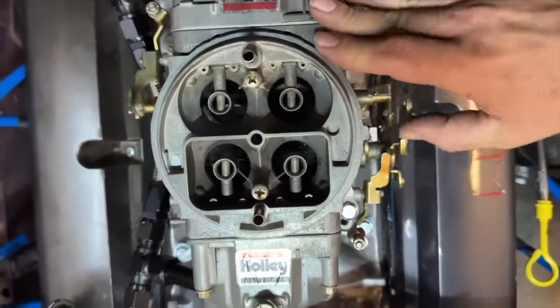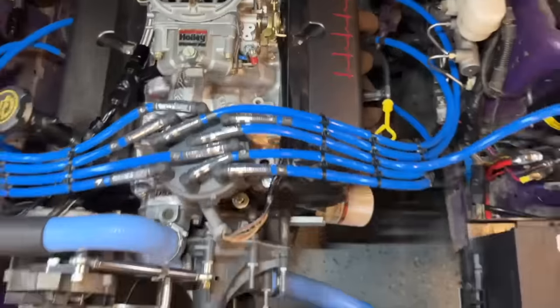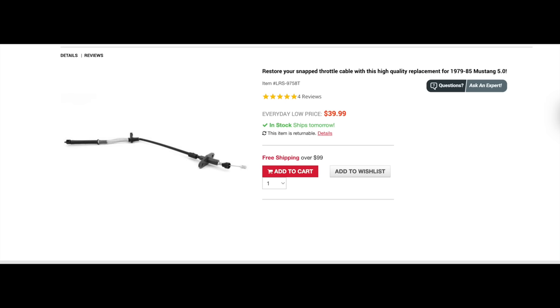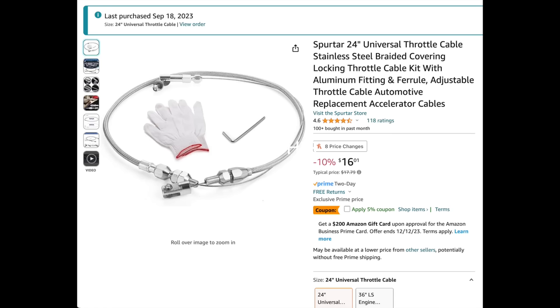It is literally that simple. Now you're going to have to have some type of throttle cable. I suggest just going with a 1979 Mustang throttle cable setup — it'll bolt right into your car. It's still a Fox body setup. Put it in the car, hook that up, and now you've got a cable that'll work on your carburetor.